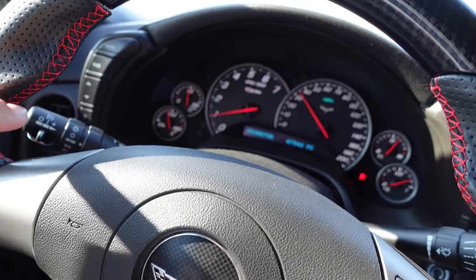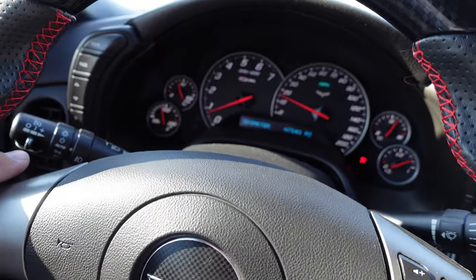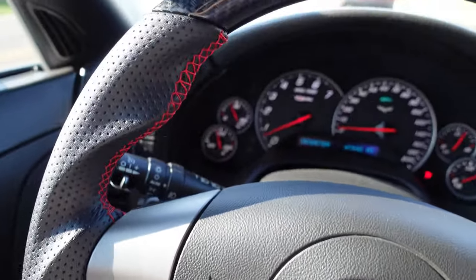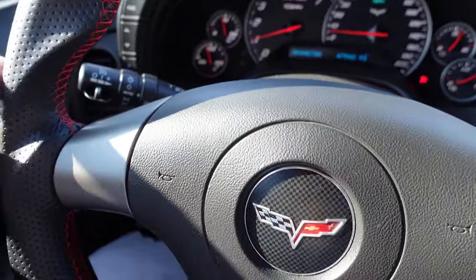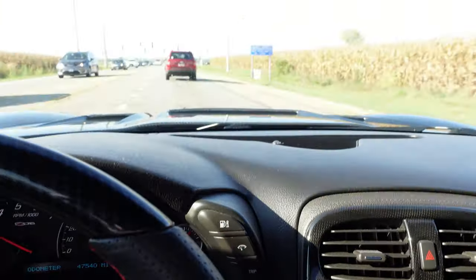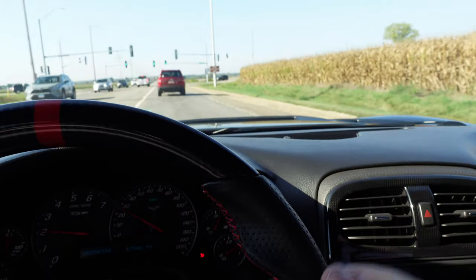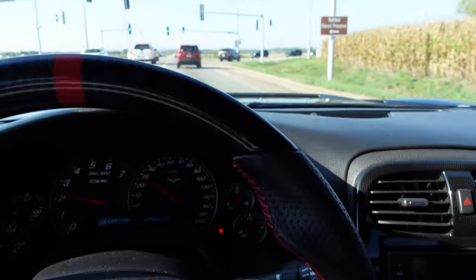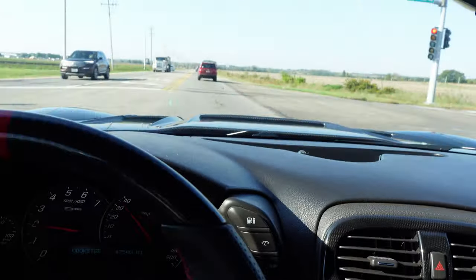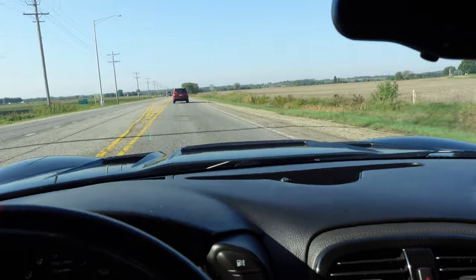Since I'm going there, I'm gonna see what his car runs at when it's up to temp. And if it's running at 220 right in the middle, which cars normally do, then we're saving some 30 degrees, which is gonna count nicely on the track. I also believe it's gonna add some downforce. Once I put that front splitter on, it's gonna drive more air inside the engine compartment and then come out the top here, giving me some front wheel downforce and help my turning out. So yeah, so far I like it.